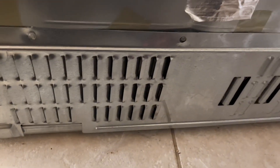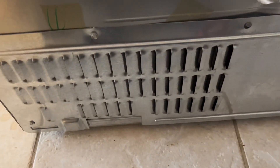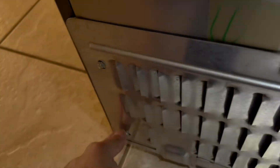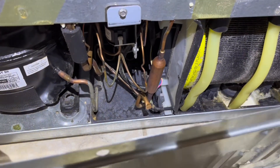Moving to the back of the refrigerator, here we have the main control board and down here we have the condenser fan, the compressor, and the inverter board. I'm going to take off this back panel — it requires a quarter-inch driver. There are six quarter-inch screws: two on the top and two on each side. Before pulling out the back panel, note that it has a little lip that goes into a pocket, and there are two small tabs on the left and right that also fit in.